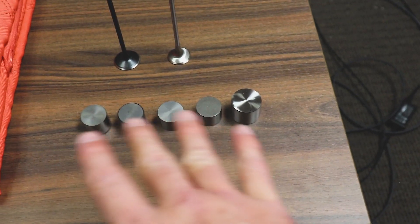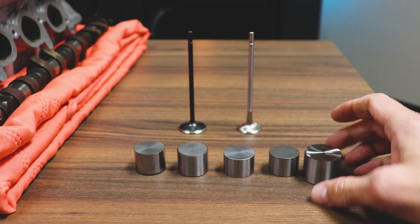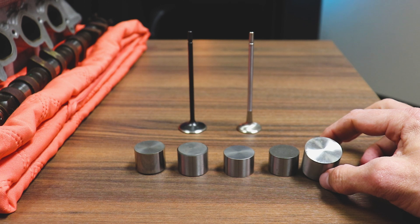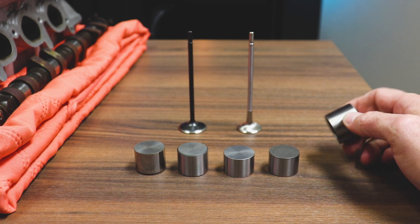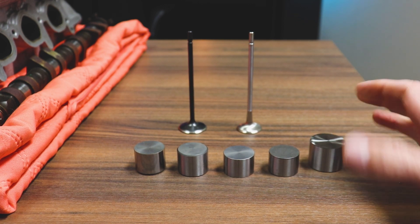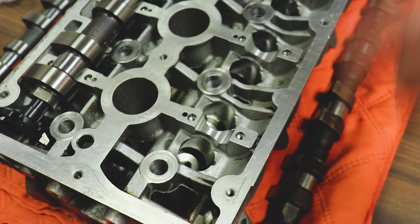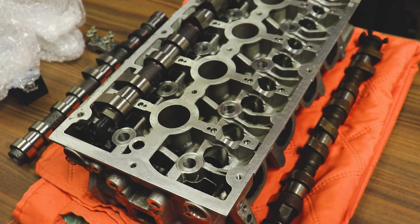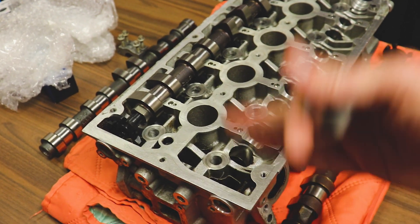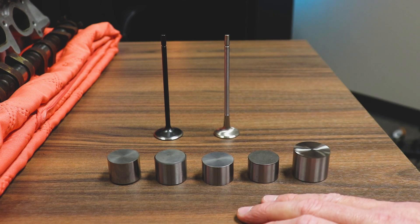The next thing I need is to get the buckets. If you look at all these buckets, this biggest one is 32 millimeters wide, and it just does not fit the bore of the American US model — it's just machined differently. These here are 28 millimeters. There's no way the 32mm is going to work without machining. So I'm really looking for a solution for people here in the States who want to do this conversion on their 1.8.